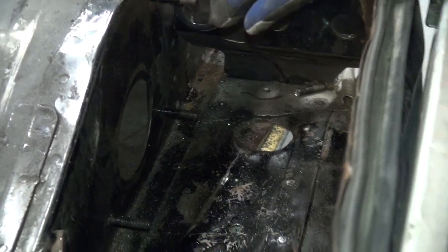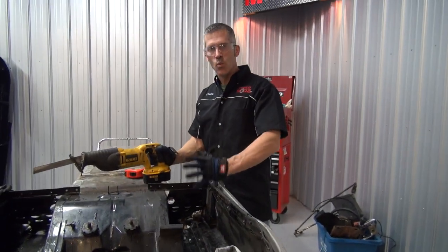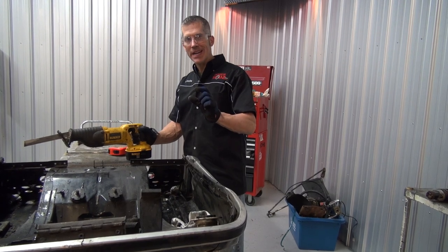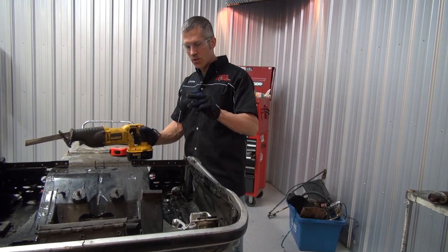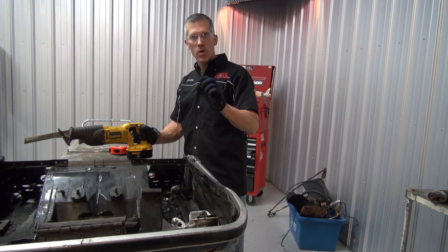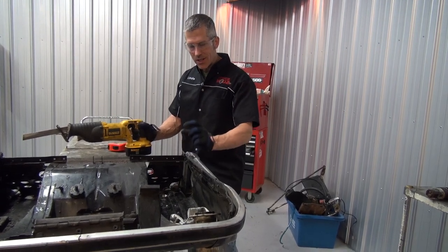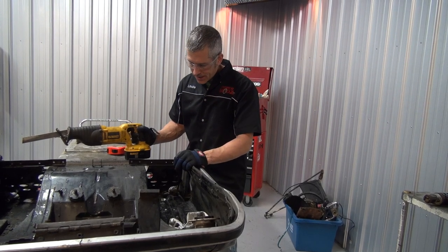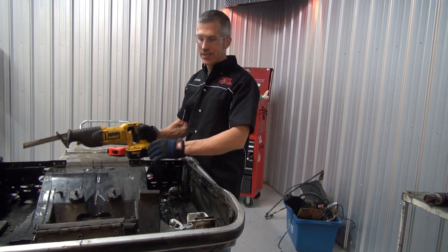The chain case that came in this originally was just way too underbuilt. And the axle shaft, I think, is about 1 inch square. It's an actual piece of square tubing with about a 1/2 or 3/4 inch little spigot on the end, or a little knob on the end where it goes into a bearing. And there's no way that would handle the 540.